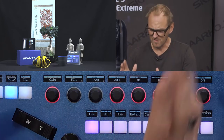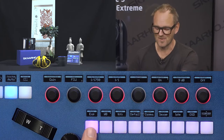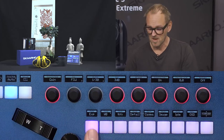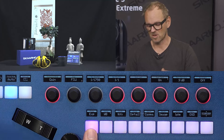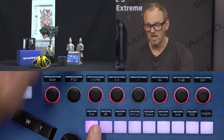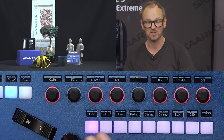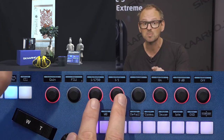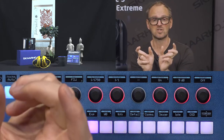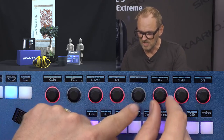This camera is so advanced that there are so many parameters associated with exposure that eight encoders isn't really enough. This button is coded as a toggle, so repeated presses give access to additional parameters. In the second layer of the exposure menu, you can see maximum and minimum shutter speeds — a way to limit the shutter speed range allowed in automatic mode — as well as gain limit and gain point.